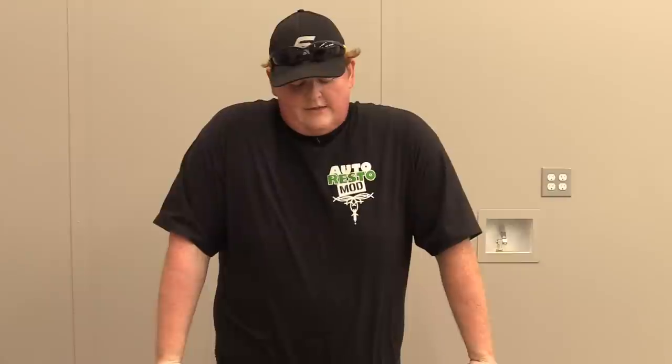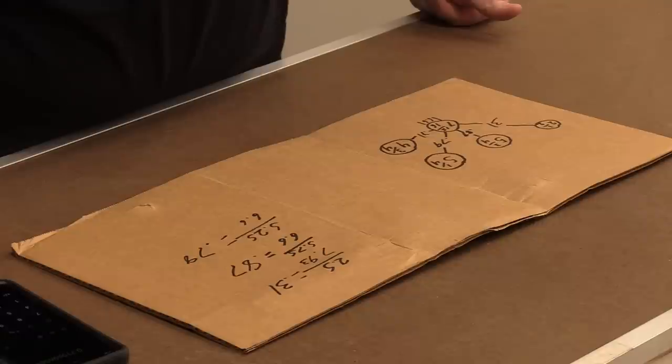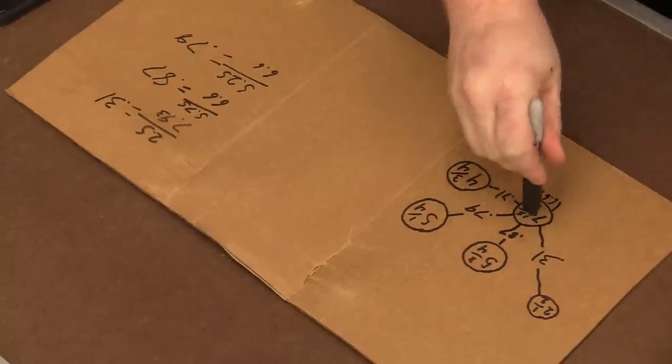As you can see, all of our pulleys are overdriven. It's not exactly a bad thing — I believe this car was set up for a lot of traffic because it came out of California, so that kind of makes sense. But also this is all cobbled together, and our crank pulley is massive. I think that's wrong for the whole setup.